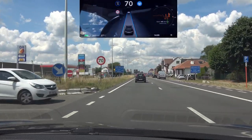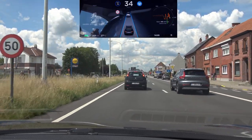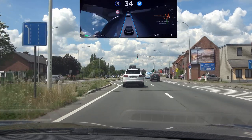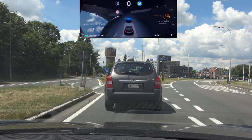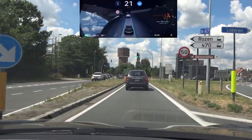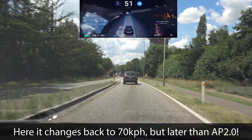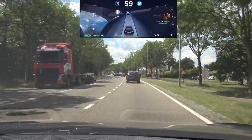Autopilot 1 cars can read speed limit signs. Here with the 50 km/h sign, let's see if it adjusts correctly. It says 50 — that's a little sooner than my car does it, about 20 meters behind the sign. But autopilot speed is not adjusted; it still says it can do 70, so you'd get a ticket if you continued on autopilot. Now behind the traffic light I can do 70 again, but there's no sign there. Let's see if it goes back up to 70 — it's losing the lane lines here, not as good as autopilot 2 at reading lane lines at that point.